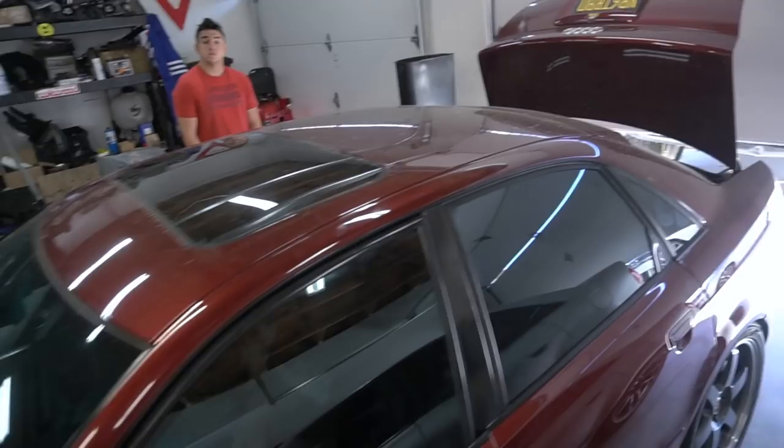Stav, is this going to be a file you could drive on once you try to start it up? All right, so as long as it looks smooth and it idles right. If it does on the first time, we'll see. If not, we may have to send a couple more revisions because we installed the 2150cc injectors in lieu of Stav's 1300cc injectors he had before. So before the car is safe to drive, a couple logs are going to be sent out.